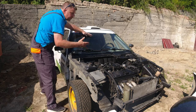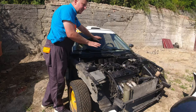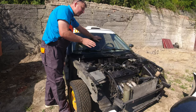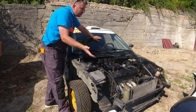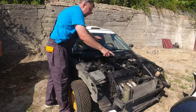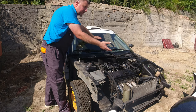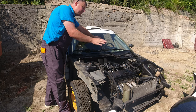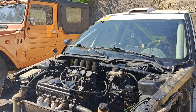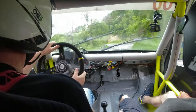So what they did to tune this engine: 4 Mikuni carbs from a bike. It's not what you think. It's only a 1400, but because it's 550 kilos, even if it was a 75 horsepower car to begin with, right now it's running just over 100 horsepower with a different camshaft and the different carbs, and the ignition has been played around with, not by me, by the previous owner. It revs up to about 7.2, 7.4, that's where the limiter hits. So it's quite good. To gain power and lose weight, they even deleted the alternator, which we found out in our first race on a hill climb.